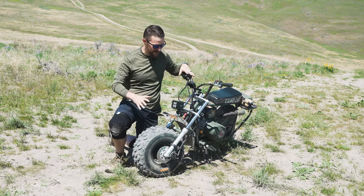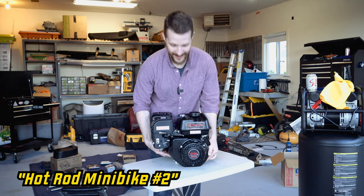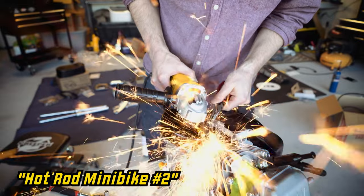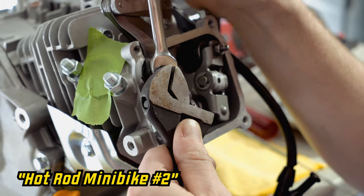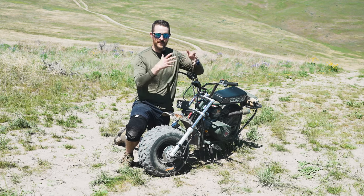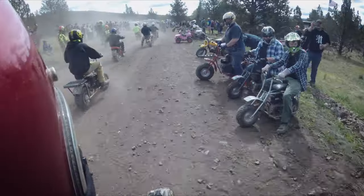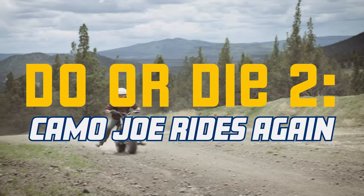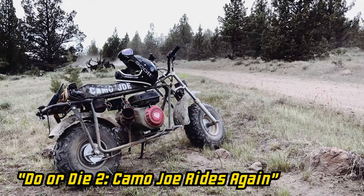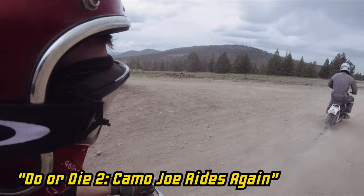2019 — phase two of this build series was the front suspension, from a Coleman CT200UEX. We tossed the original engine, got a Predator 212 Hemi engine, did the same governor delete, reinstalled the same carburetor, upgraded the valve springs, and installed a 30 series torque converter — which deleted the possibility of that crappy centrifugal clutch falling apart. The race in 2019 was awesome. We didn't finish — got about 65 miles in before a chain snap, hence why I carry a replacement chain. But that video is still one of my top favorite videos on the channel. You should go watch it.